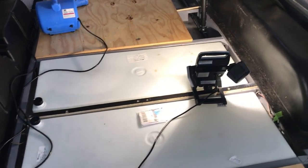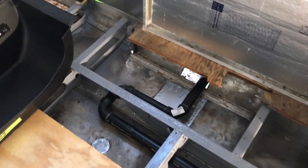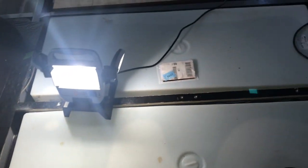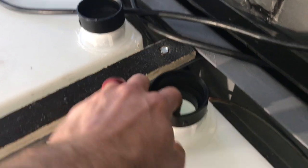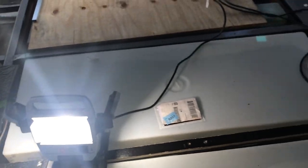It's about 8 a.m. We have filled up the gray tanks through the drain hole for the bathroom sink, and we've got the system totally closed off so that we can pressure test the tanks and make sure everything is holding well. The water is filled up so it's just barely into the black part of the valve, and I'm not seeing any water leaking so far. This was also a major test of our design for retrofitting this for gray tanks, and so far everything seems to be holding.